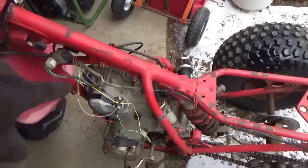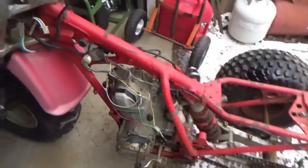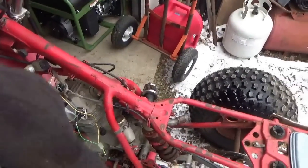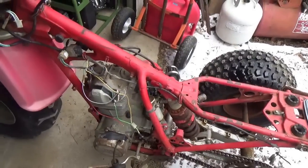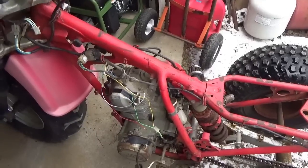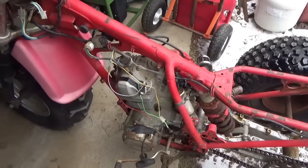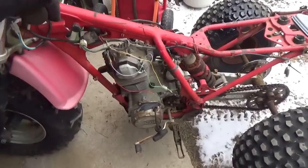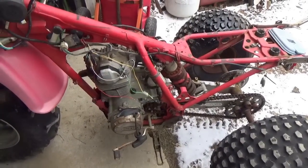You can also see from the beginning of the video why I like to use my portable CDI box. The portable CDI box takes the handlebar switches, the pulse generator, the coil, the harness, all those grounds — it takes all that out of the equation. It's just a matter of: do I have a good spark plug, and do I have a good pulse generator at the correct timing? Anyway, I hope this helped. Please keep your feet down, keep your heads up, and get out there and enjoy each and every day. Bye now.